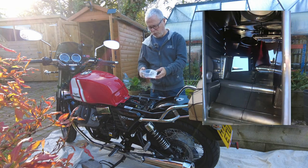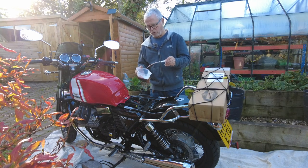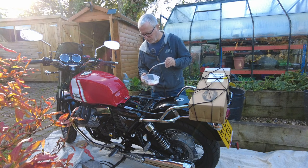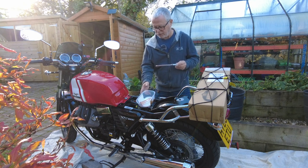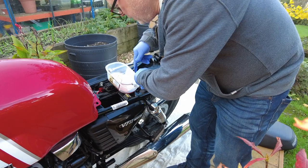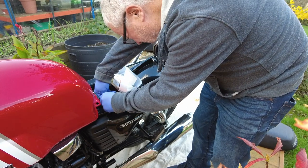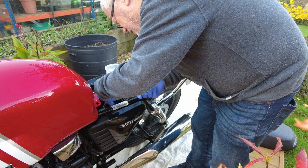What I'm going to use to drain the oil from the air filter box is this little gizmo here, which I found useful for pushing down the dipstick and removing surplus oil. There's a small box here to catch the stuff and a small syringe. I'm going to pull up the surplus oil until it's dry and then wipe it down. I've also added rubber gloves because it's all messy stuff in here.